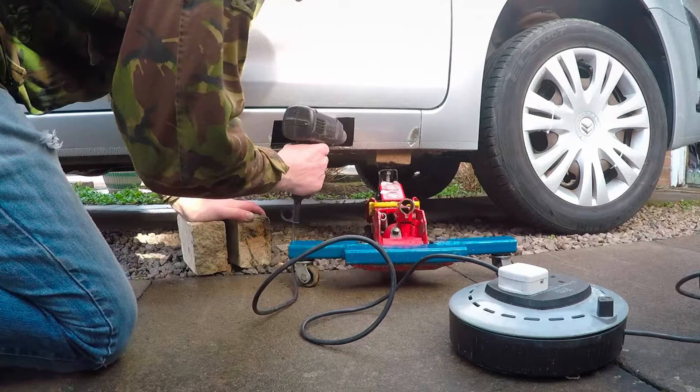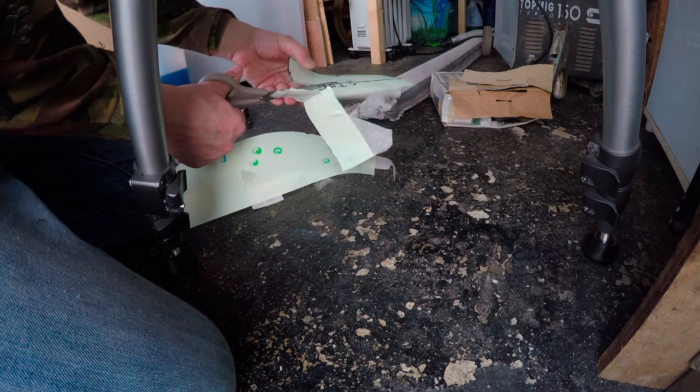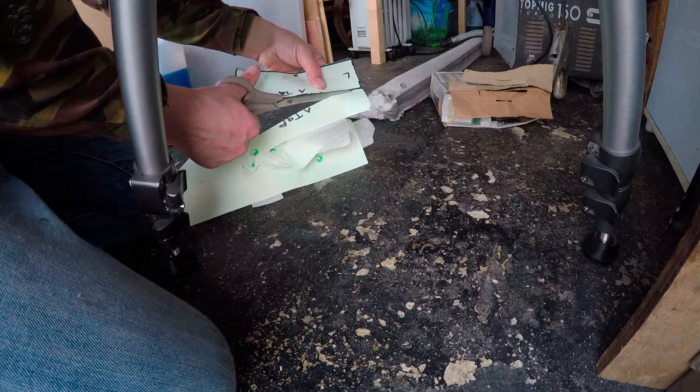So I'm marking out my panel, the size. Don't forget to put your top, front and top left on. Just cutting it out here, giving it a little bit extra in the height, because obviously that's where it's going to be curving around, so it's going to take up a little bit more height if you're not careful. Getting the profile of the sill.